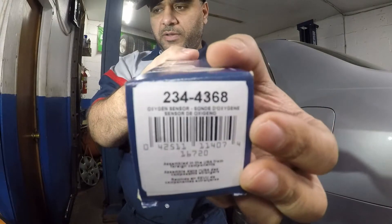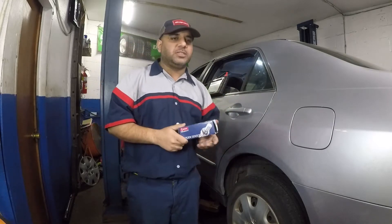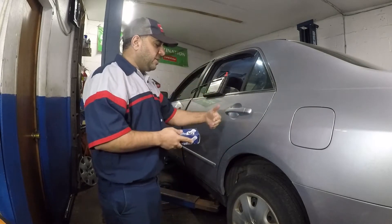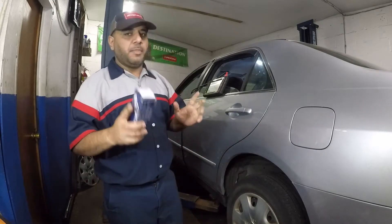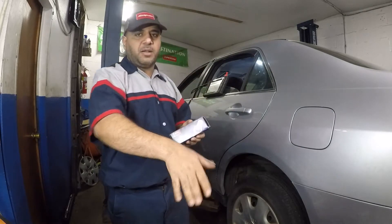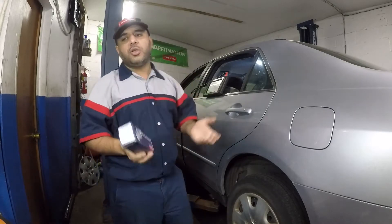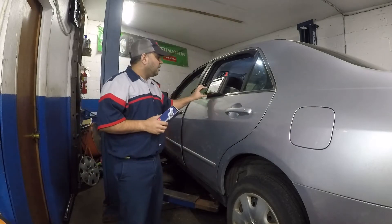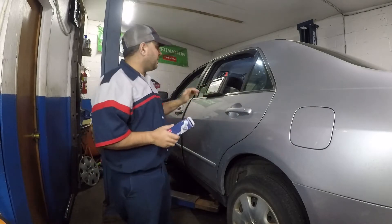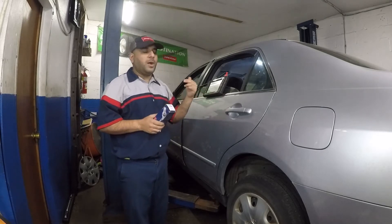This code is for bank one, sensor two. Usually in a six-cylinder car you will have bank one and bank two. To determine which is which: on this car the engine is sitting this way and the belts are that way, so the right side — cylinder number one — is on the right side near the firewall. That sensor is all the way in the back at the bottom. Bank two is the one close to the radiator. The code here is P0139: heated oxygen sensor, bank one, sensor two — slow response.